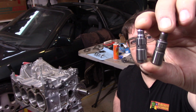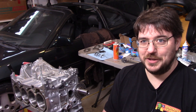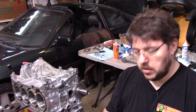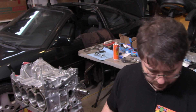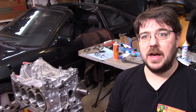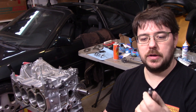Continuing on the topic of valve control, I got this. On the left is the stock hydraulic lash adjuster, and on the right is something I found in the Toyota parts bin — it's from some diesel application, took a whole bunch of searching to find. Like everything else, I now have a giant pile of hydraulic lash adjusters from all kinds of different applications, because the internet will only get you so far — after a point you need to get them in your hands. First, the piston area is a tiny bit bigger on this one, which will result in about 10% more oil pressure, which should be nice. And there's a little groove up there for a retainer — similar to this design with a little clip that goes onto the rocker and holds it. Unfortunately this clip is not the right design for what I need, and I haven't been able to find an existing clip I can use. So I either need to modify the rockers or get some different clips made. I'm going to run it without a retainer since the factory doesn't have one, but if that ends up being what makes the difference, then I'll do that.